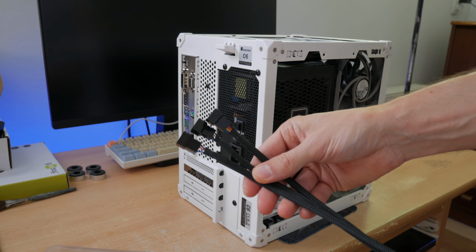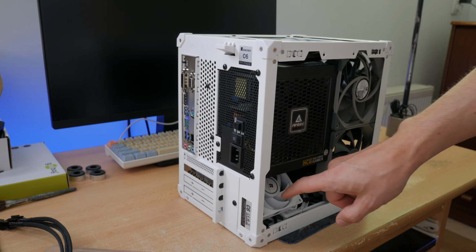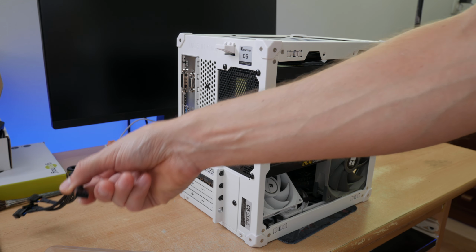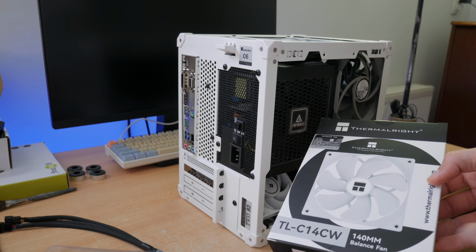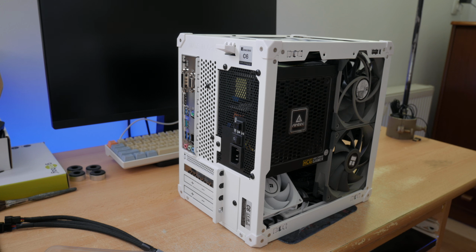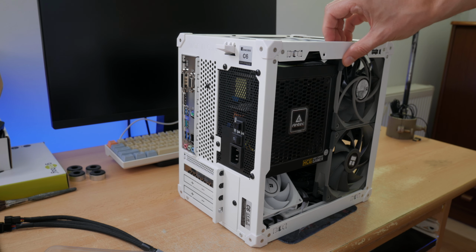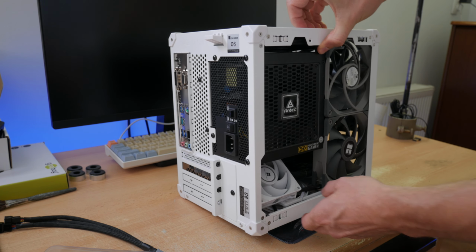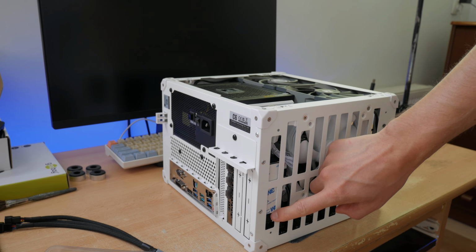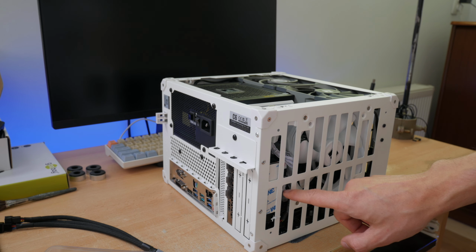So in this case I can connect 3 fans to one header, but I have 7 fans in the PC case. Now I could only use 2 of those headers had I known that this 140mm version comes with that plug, but since I didn't know that, I actually used something else, which is a fan hub. In this case, it can connect up to 8 fans, or maybe 10. It most likely will not be visible. I just have a sticker visible down here, but I have connected 3 fans to this one.